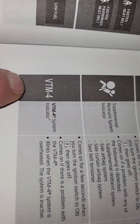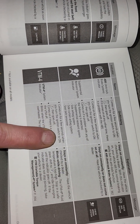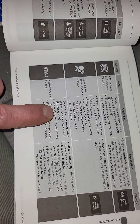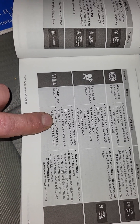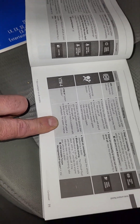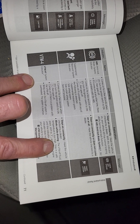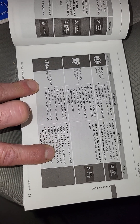This is the second time we've had a question about the VTM, and we're working on a Honda Pilot. I was misinformed myself — I think it came from YouTube. So we're gonna see what VTM says here. It comes on for a few seconds when you turn your ignition on, then goes off. It comes on if there's a problem with the VTM4, blinks when the VTM4 system is overheated and the system isn't active, and stays on constantly if you need to have the vehicle checked by the dealer.